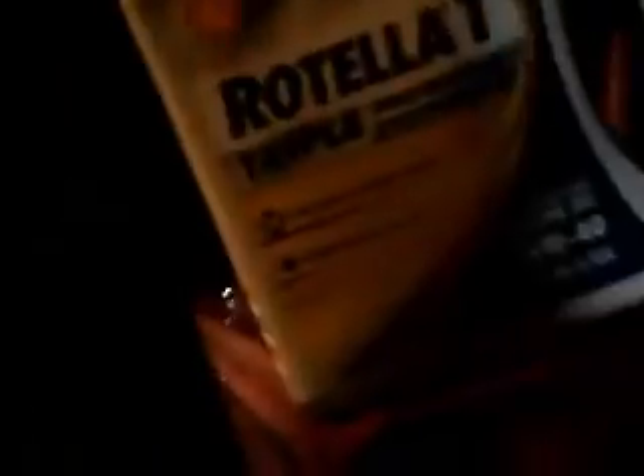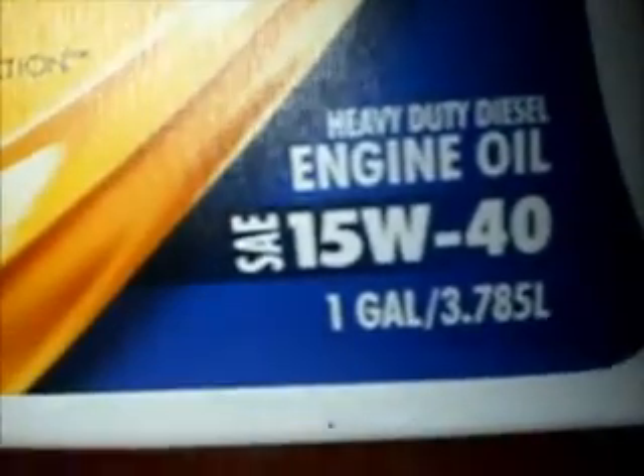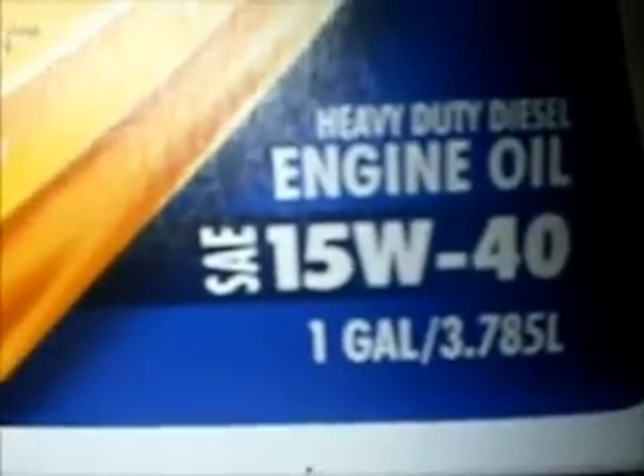While that's draining out, I just want to show you what we're putting in. That's the oil we're going to use. Note that it's an old design for diesel engines — it's a 15w40. The service manual recommends that for multi-grade oils, 15w40 is for a climate of 10 degrees Fahrenheit to 100 degrees Fahrenheit and beyond. So for the climate here in South Carolina, that's going to be just perfect.